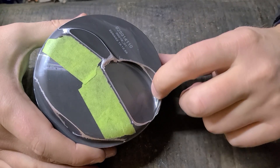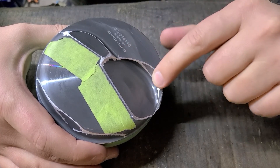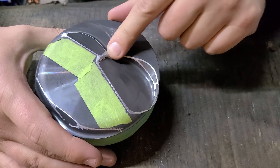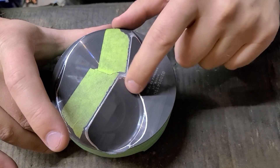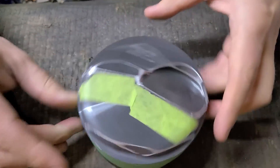This spot right here — unfortunately there's not much you can do about it because it's so thin, so all I did was remove the high points and sharp edges. I still feel this is a vulnerability spot on the piston, but what can you do? The rest of it though is smoothed out, and I focused a lot right here, which had those really sharp multiple angles and different kinds of points — so all that is gone, and I feel like we are safe now.